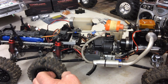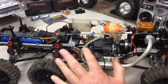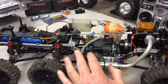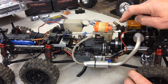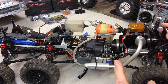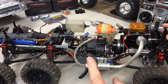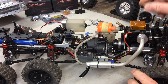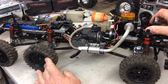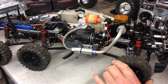I've got a brake servo on here. I did have the throttle linked up to the brake servo — like a normal setup with brake and throttle together — but the problem was you had to have the throttle stop screwed in to keep the engine ticking over when braking. The only problem with that was you couldn't stop the engine; when it was running there was no way to stop it unless you put your finger over the carburettor or lifted the body and shut the fuel off, which was a lot of fiddling around.